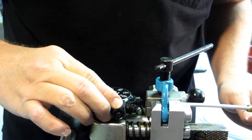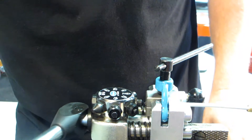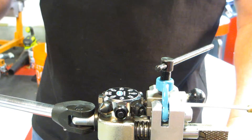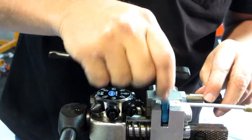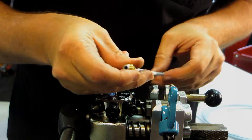Now you're going to move to operation two, which is your three sixteenths operation two. Make sure that the center peg lines up nice and tight. Pull on it and once it bottoms out, you're done. Now you have a perfect double flare. You loosen your clamp, remove everything, and you are all set — both ends.